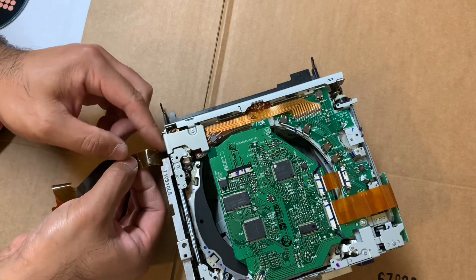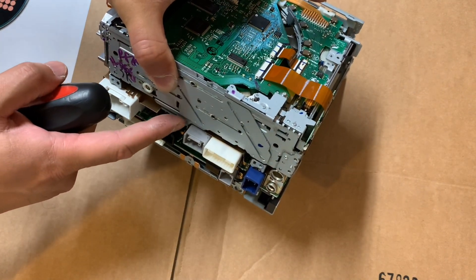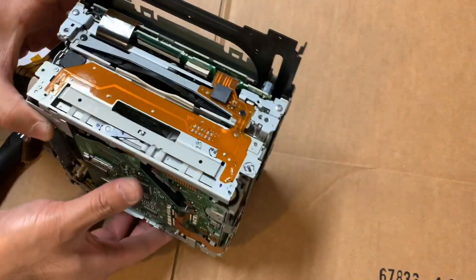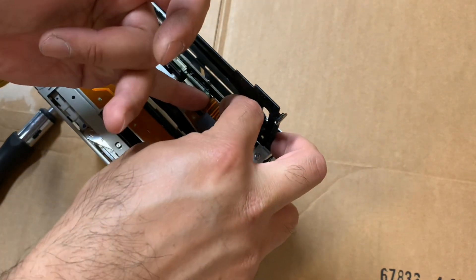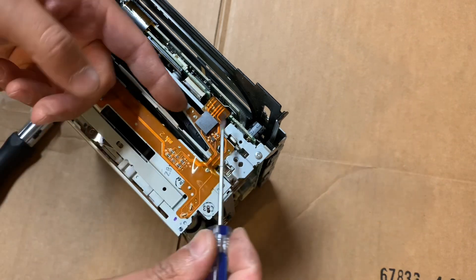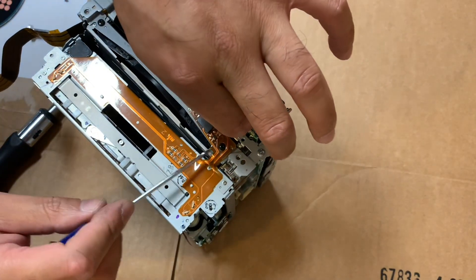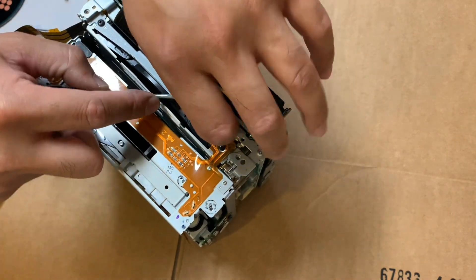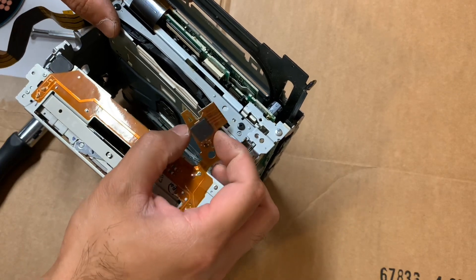So that we have a little bit of clearance to remove the drive. The top CD changer — it's a four-disc CD changer — this particular model is held in by one central screw right in the center there, so go ahead and remove that. Once you remove the screw in the rear, this unit does come a little loose. Flip it to the front where the discs go in and remove the ribbon cables. You want to pop this ribbon cable up towards the face — there's actually a wire connector underneath. This is all adhesive, so just gently pry this up and remove it from the glue. Once that glue is removed, the CD changer slides right out.